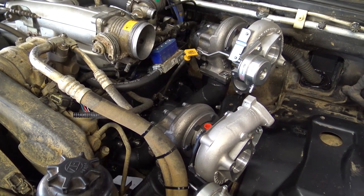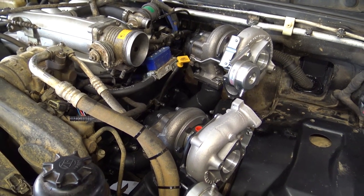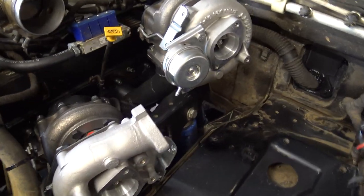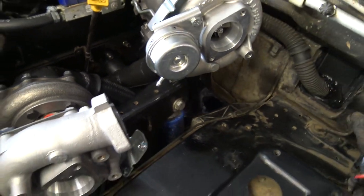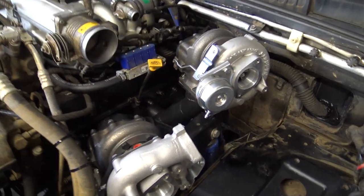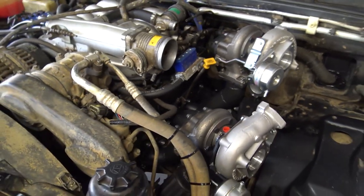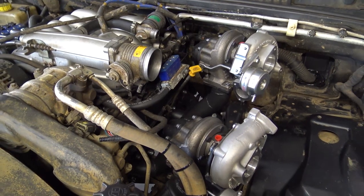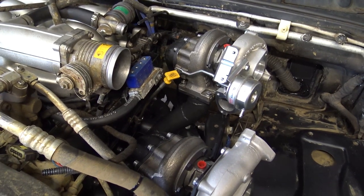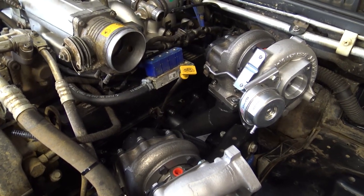Office Steve is away this coming week so he won't be able to edit anything for me, so potentially I'll be a little bit after this. If not, then the next video will be firing up with all the other work done. Just to show - the downpipes are actually on and connected to each other, so I've got the rest of the exhaust system to install as well. But yeah, going well. I've realized I'm going to have to make up a heat shield for my LPG injectors, because they are closer than UK LPG guidelines allow to the exhaust. Therefore they need a shield, and I have got turbo jackets to go on, but I'll put an additional shield on as well. Can't be too safe for this.